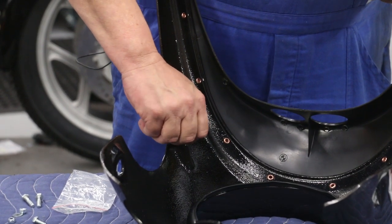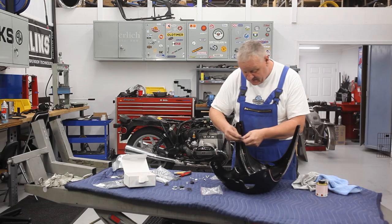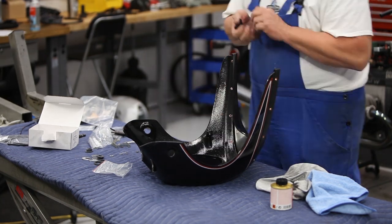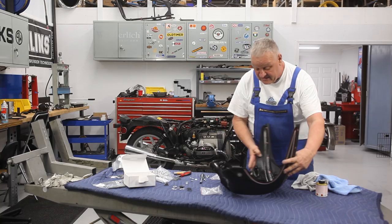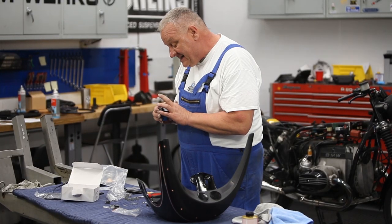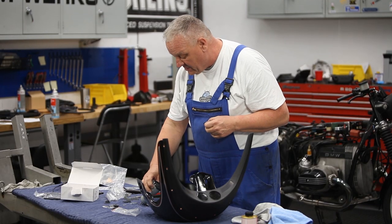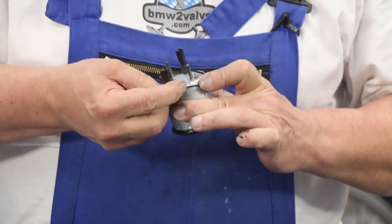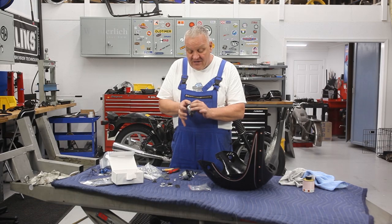First I'm just going to make sure the threads are okay — don't want too much paint on them. I'm sure Dustin plugged those off. We'll just set those in like so. These look much better — at least there's no big chips in the paint. I'm going to pull my masking tape back off. Looking real good on these instruments. There's a little O-ring that goes in there — a lot of times you wouldn't know it because they're cracked and disappeared a long time ago, but there is supposed to be one, so we're going to put one on. It mainly helps keep the gauge from rattling around.